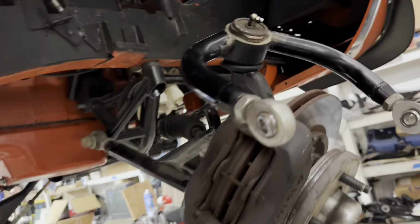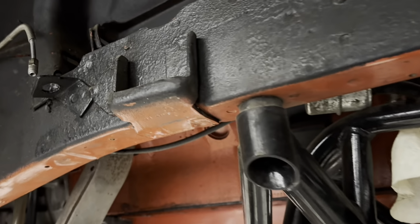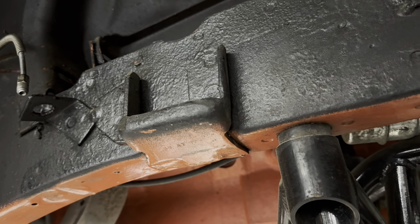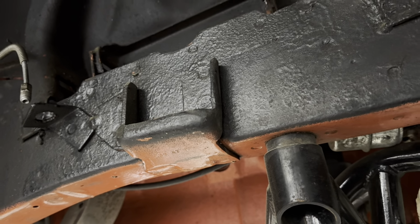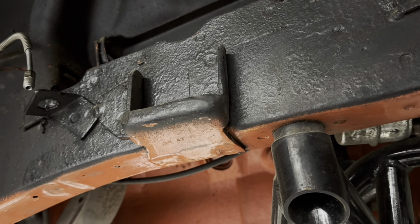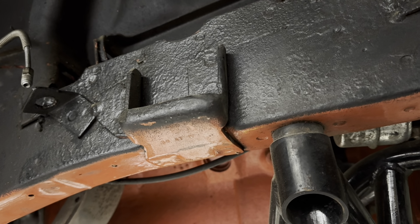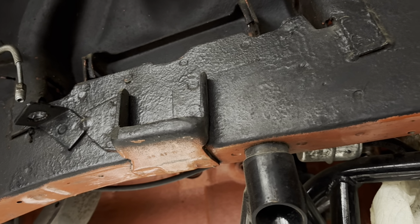All right, got the rear wheels off. We're gonna go ahead and pull the drums and of course inspect everything, get the rear done on the drums. The front coilovers are off. We had a little hard time finding a 12mm socket for that, or Allen, I guess. Fortunately, Jamie had one, so we got those loose. Another thing I noticed, which again makes me extremely angry and annoyed, is they actually cut off the upper control arm bump stops. Apparently that's in the way of a Magnum piece, so I need to find one of those now, which is not gonna be easy because I think this is just B-body and E-body, 71 B-body. So I'm going to have to do some research on that, but I'm assuming those are different and I need to find that piece now, which theoretically I could do after I put the suspension in, but it's gonna be so much easier to do it now.